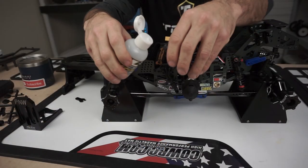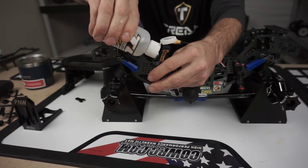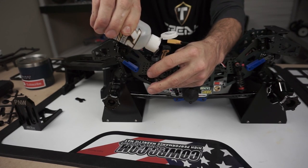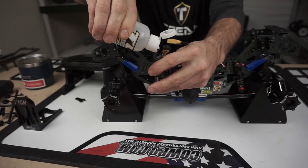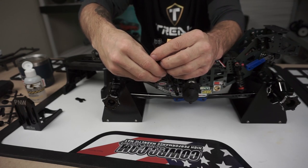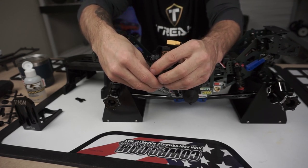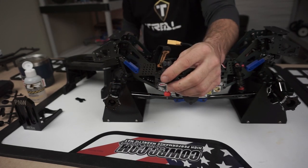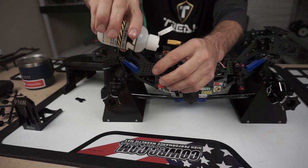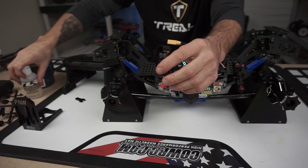What I like to do is hold down on the shaft and pull it down slowly as it goes in. Fill it all the way, almost to the top. Go ahead and run your piston up and down a few times — there come the air bubbles. Then fill it, top it off, and let it sit for five minutes so we can bleed it with the least amount of air bubbles.